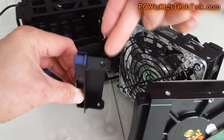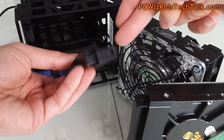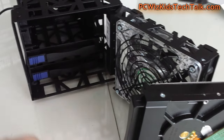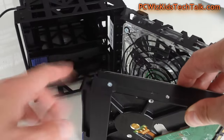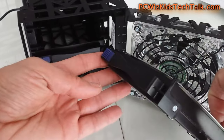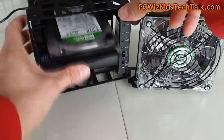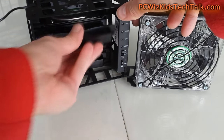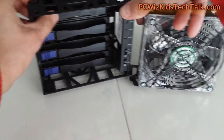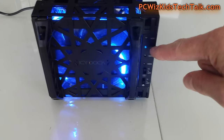Taking the little latch out here, you can see it has options for screws on either side, so you will have to attach it to your hard drive — I've already done that in the interest of time. You can see here it's already installed. It's just a matter of sliding the drive into the drive bay and then latching that lock into the lock position. You would do that with all four drives should you decide to buy four. You don't have to buy four — you can buy two and then later on get the other two. It has the expansion capability, which is great.